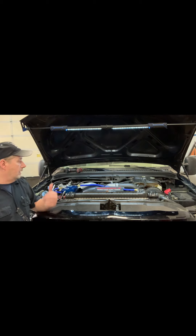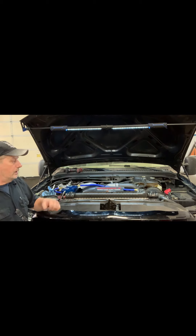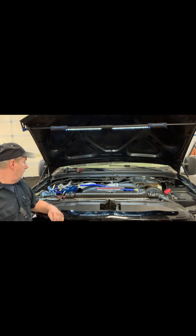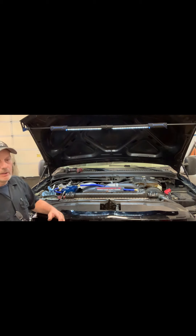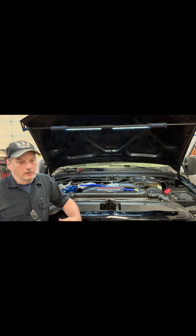Anyway, got that taken care of. I'm going to replace the H-valve because they're pretty cheap, put it back together with some new O-rings, charge it up, and it should be just fine. Back to the oil — stop adding oil to the system. When you buy a compressor, generally nowadays they come with a full charge of oil. The instructions tell you to dump the oil out, measure what's in there, and put that amount back in.